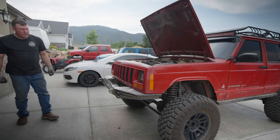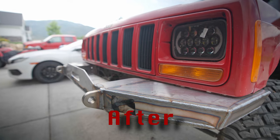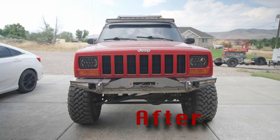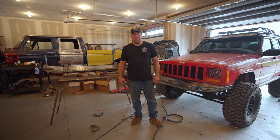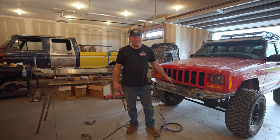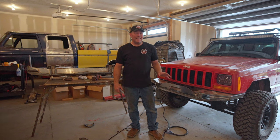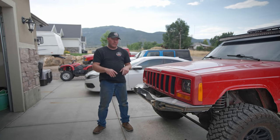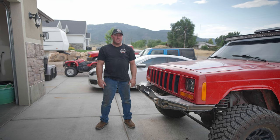I'm not sponsored by these guys, but these front and rear bumpers for a Jeep Cherokee are from JCR Off Road and I'm super impressed with them. They're made out of 3/16 steel, the cuts on them are excellent, and they're super easy to put together. If you have the means for a DIY bumper you can weld together yourself, I'd recommend these. We got this bumper all welded up, everything fits good. On the next video you'll see us painting the front bumper, the sliders, and the rear bumper — and then maybe testing them out. Thanks for watching.